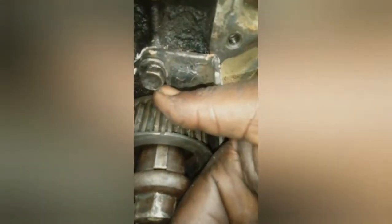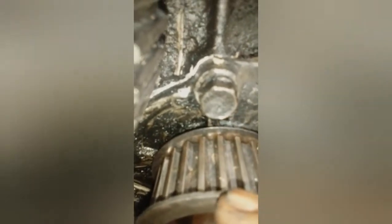This is the timing - this little mark lines up with the marker. After the cam timing, now we are going to the crankshaft. Keyway up, straight up. You can see this mark behind the bolt down here - that's where it lines up. So you line it up right here with the keyway and this mark. That's where you catch the crankshaft timing, along with the camshaft timing.